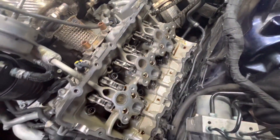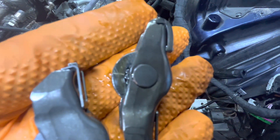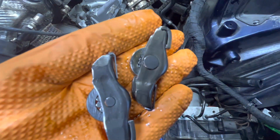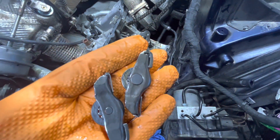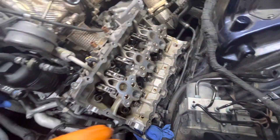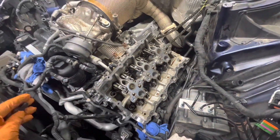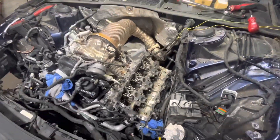The reason we're doing it: I already stuck two updated ones in, and the other ones are still original. You can see the original one has little pins for the bearing, and the updated one has larger pins. Those bearings fail, start to clatter and fall apart, and metal goes into the motor — pretty scary. This one still sounded good and appears to be in good condition, so we're just doing it for preventative maintenance since he's planning on driving this car for a long time.